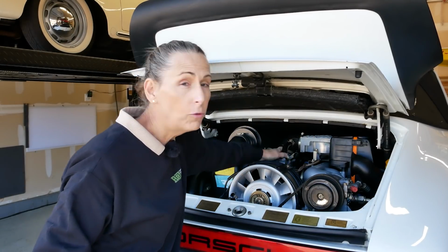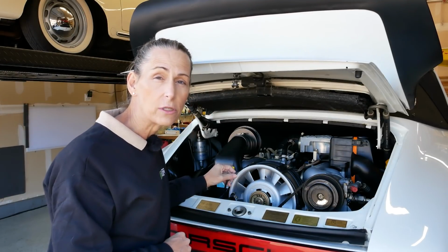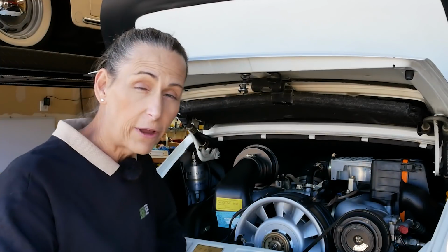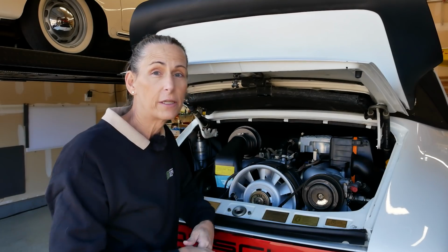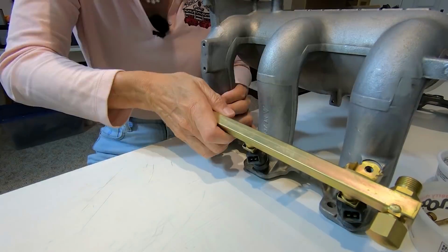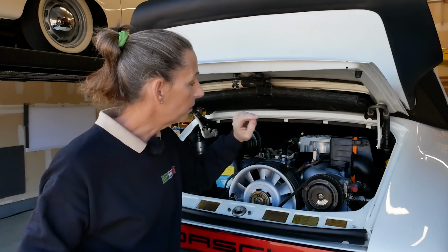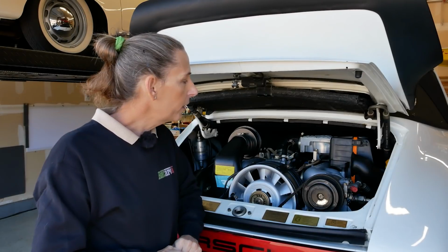Up here, our fuel metering and all of that is going to be distributed across the entire engine. So we'd expect all the cylinders to see the effect, but we're only seeing an effect on just this one cylinder. So it can't be the fuel rail, for instance. Why? Because it's just a square tube, really, and it feeds all 3 injectors, and our forward and rear injectors are working just fine. Well, what else could it be?